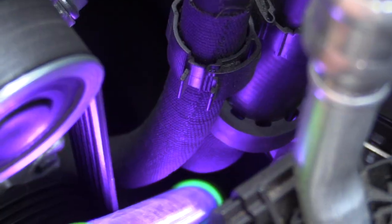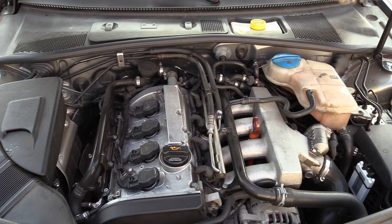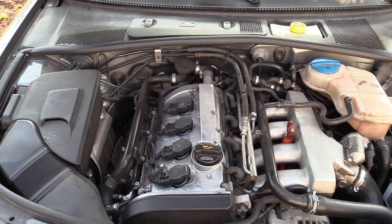When it comes to checking for a coolant leak, there's a couple of methods you can use. You can do a simple visual inspection and look for the leak, keeping in mind that coolant and all other fluids will leak from the top down, so you usually want to start at the highest point on the engine. You can also use a specialty coolant dye paired with an ultraviolet light to trace sources of a leak. And remember, your car's cooling system is designed for a very specific coolant — always make sure you're using the proper coolant as recommended by the manufacturer.